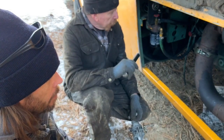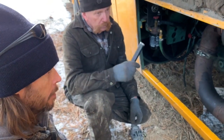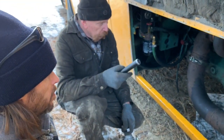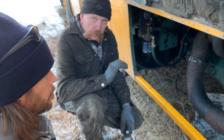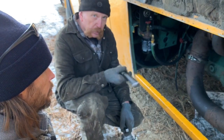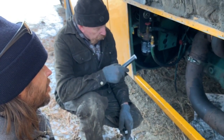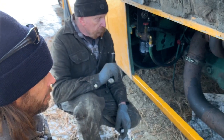They're squishing them down in LA. With California emissions, they're just crushing them, getting rid of them. This guy in Wenatchee just paid $17,000 to have a 671 in-framed. All an in-frame is a repair. All they do is pull the head, put new pistons and liners in, and put the head back on. He got robbed, because $17,000 would pay to have that removed and completely rebuilt out of frame. So whoever did that to him took him to the cleaners.